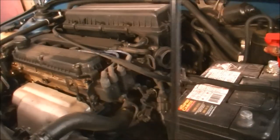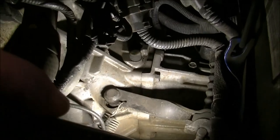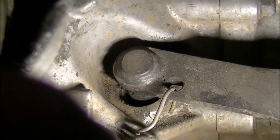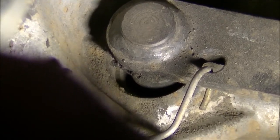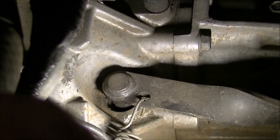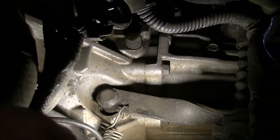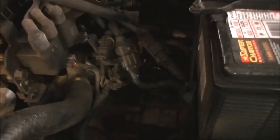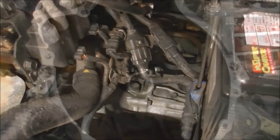When I had a look at it - I'll just put my torch down here for you - that's the pivot. If you look closely at the pivot, the bush is worn out where it goes into the bell housing there. That's what operates the fork. So I'll slide the box out, and you can buy all those bushes genuine. We'll replace those bushes and it should all be good as gold.